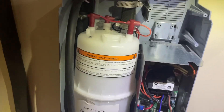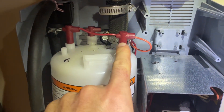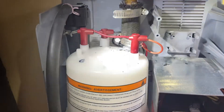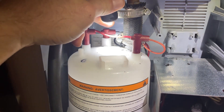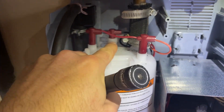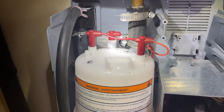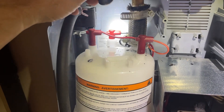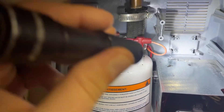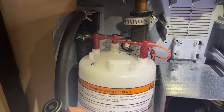One thing I noticed right off the bat — this is not good. These connectors look like they're all interchangeable, and here's what's suspicious. You notice we have two thick gauge wires in non-symmetrical locations. Now this thing has a fill sensor, and I'm guessing that is the fill sensor. And this is the element inside. This looks like a sensor wire to me. So let's get on the schematic and see what the deal is.